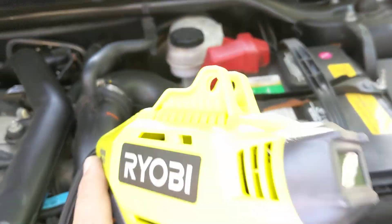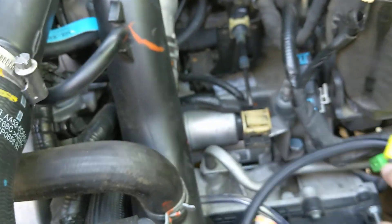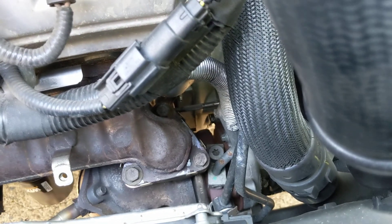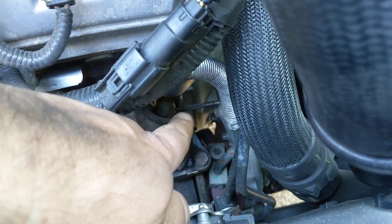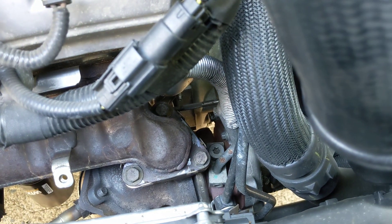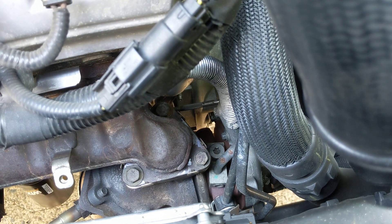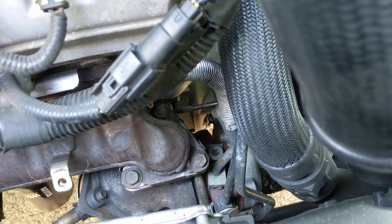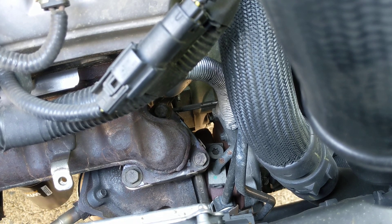On this actuator I have a vacuum hose hooked up to it, but we're not pulling vacuum — we're putting in pressure. I've got a little tire inflator here and we are checking to see if that wastegate actuator does in fact move. You see that metal arm right there? That is the wastegate actuator. If that moves when we apply pressure, then it is good. And you can see it moved — no problem — released the pressure and it moved back. So we know the front turbo wastegate actuator is good.